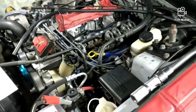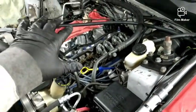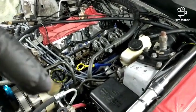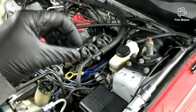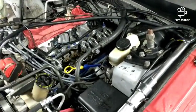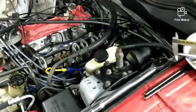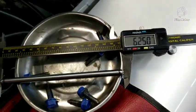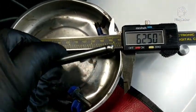So I went ahead and continued taking it apart, retorqued the lower. I started putting the other pushrods in and noticed that when one of the rockers was on the base circle of the cam, the pushrod — I could spin it. When I started putting the new ones in, they wouldn't spin anymore, and I noticed it did press the valve spring a touch. So I measured the stock pushrods — 6.25, just like they're supposed to be.